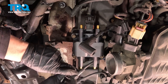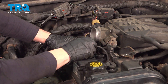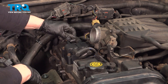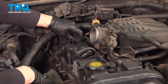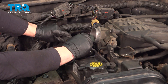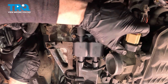Number one cylinder, number one spark plug; number two, number two. We're going to put two on first, see if we can keep it from bending and getting in the way. Three and four — four is the furthest one away, three is in the center. Connect our IAC valve and our throttle position sensor. Push that red tab in.